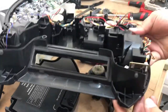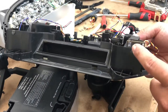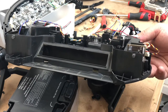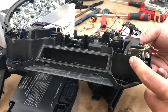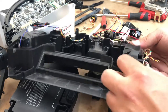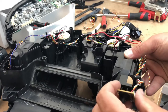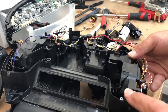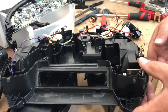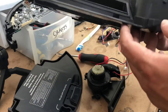Before we reassemble this, let's talk about the other issue on the other robot. It's this little button right here that the bin presses. This could be caused by the button going bad or wearing out — you just pull it out very gently and replace it. Or it could just be that the bin is bad, which I believe is the issue since that bin is broken. Super simple fix on that one.